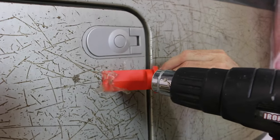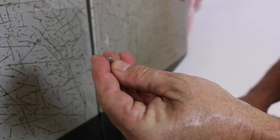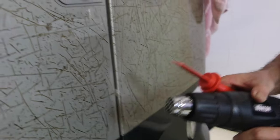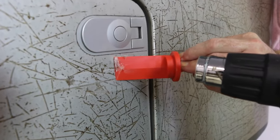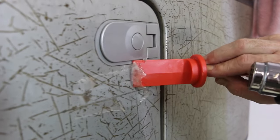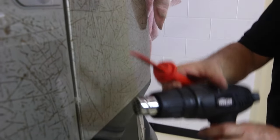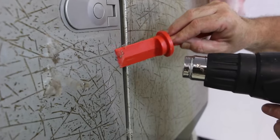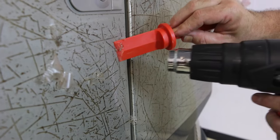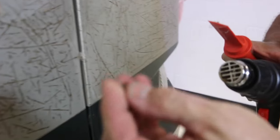I've been doing this a long time, so I can make passes like that no problem. Here's the trick: when it starts to get real hot and gummy, that's when you're going too hot. But if I can hold it and do this, I'm keeping the temperature nice and even — this far back, scraper just like that, nice and easy. This is not a race. We're not trying to get this done in an hour. Just do little passes. Now if I get this too hot, you can see the difference — it's real gummy, and that's what you don't want. Just nice and easy like this.